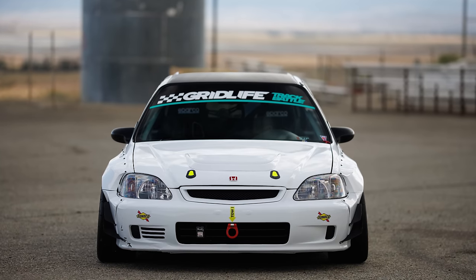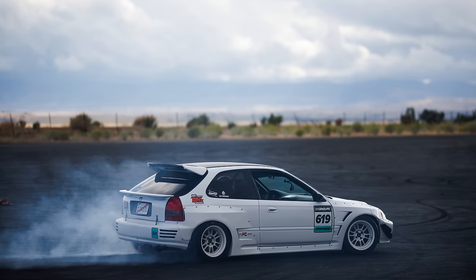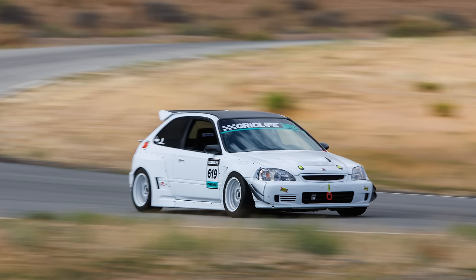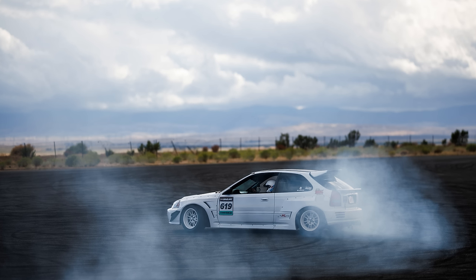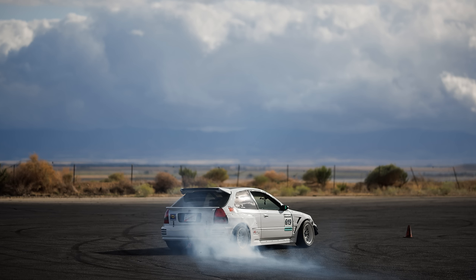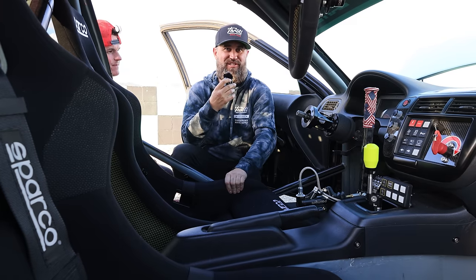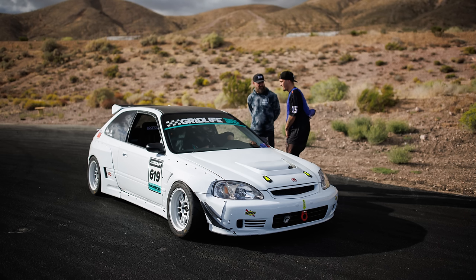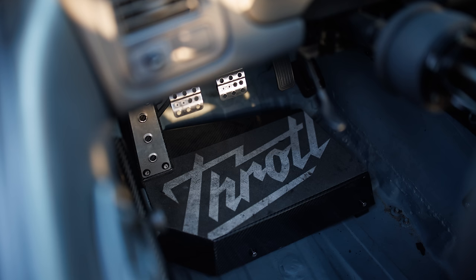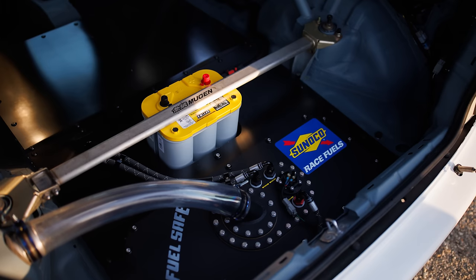And that's only half of the recipe though, Larry, because how do you pass axles through something that never was meant to have axles in it? We worked with S1, who is known for all-wheel-drive cars. The guy's name is Sohn, awesome dude. He custom made us rear arms that bolt into the factory locations that have axle splines on them. It uses an Integra hub bearing with axle splines inside of it. It's a really neat thing. You don't think about all this stuff until you actually go to do the project, and you're like, oh, I need to figure this out. Oh, how am I going to hang a diff in here?